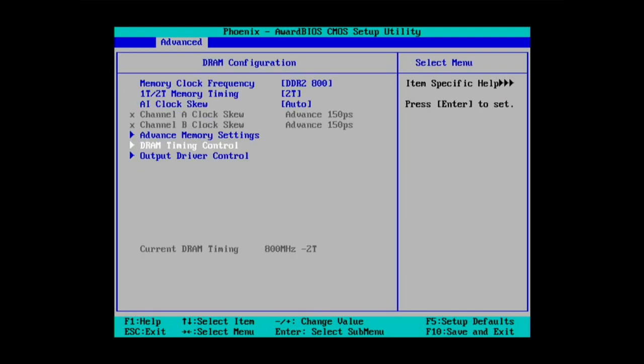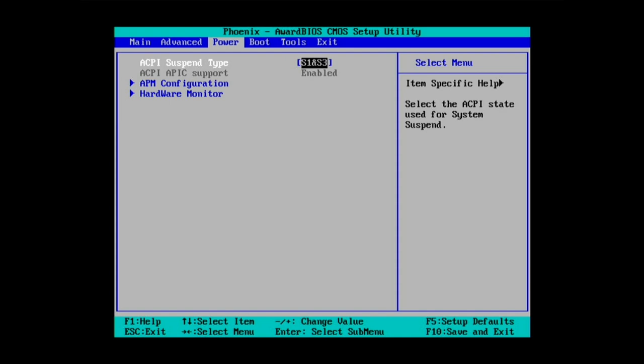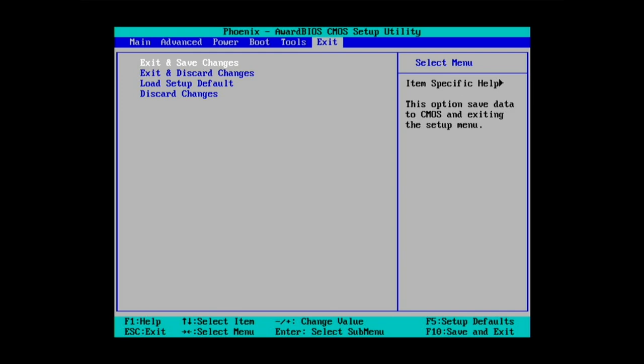So I basically have to pick between fast memory or a slightly faster CPU. Going from 800 on memory to 1066, that's an increase of like 32%, I think. I'd rather take that over a 3-4% overclock on the CPU, even if those percentages probably work more than the equivalent percentage on the memory. The performance doesn't scale with memory bandwidth that much, but yeah. It's more fun because the CPU clocks like garbage, so you're not gonna notice any difference between 3.2 and 3.3. So now we have all these settings done, we can start.